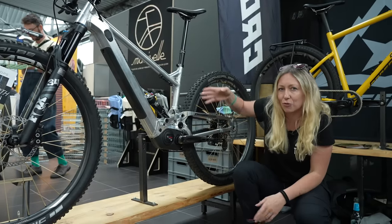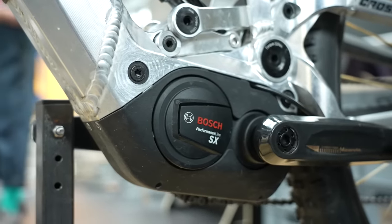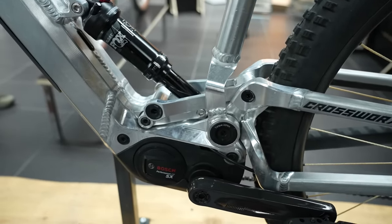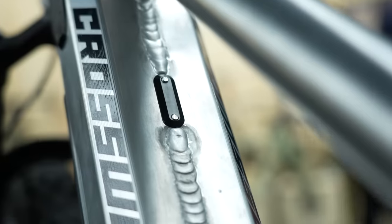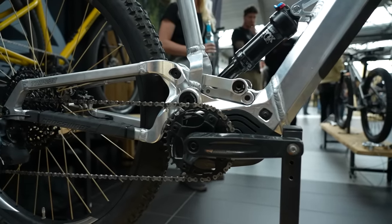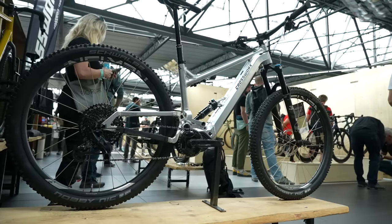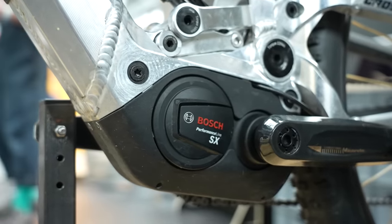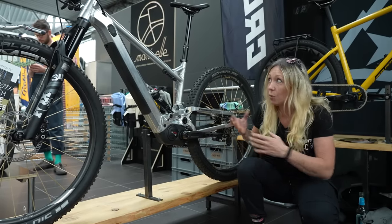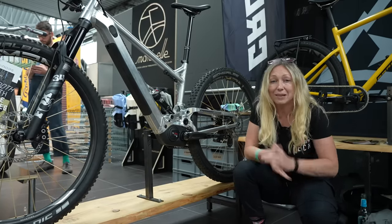I know I'm not EMBN, but this is the Crossworks Trip, and it's really interesting to see an e-bike here at the Handmade Bike Show. This is in prototype staging but very close to being finished — it should be out by December 2023. The down tube has been CNC machined in two parts and welded together out of aluminium and welded to the aluminium tubes. In finished production this would be more of a moulded piece. It's a 140mm trail bike — perhaps aggressive trail — with a 66-degree head angle and a Bosch Performance Line SX motor.